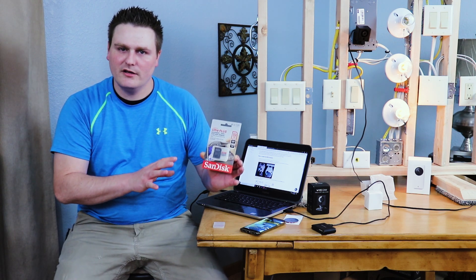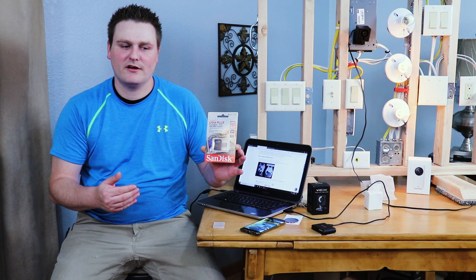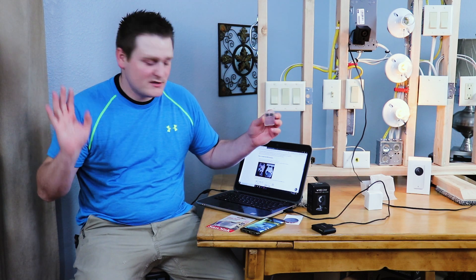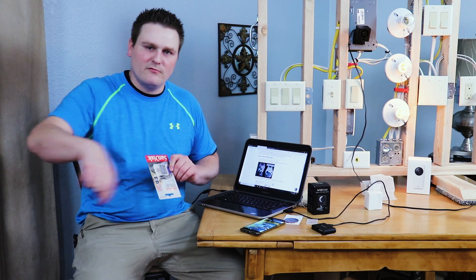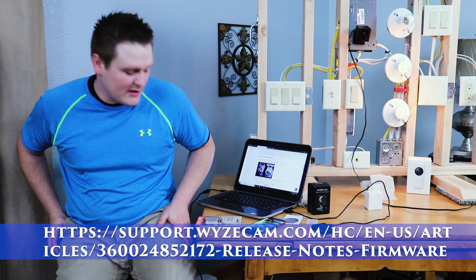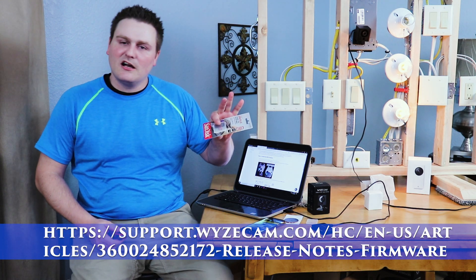It has to have the V10 for it to be able to flash. I tried different brands — just get the V10 and it'll work for you. If you're wondering why your RTSP isn't working or why it's not flashing, this is why. I've watched three or four YouTube videos and none of them mention this, which is very annoying. I'm gonna go to the Wyze webpage — I'll have it linked below where you can download the firmware, and I'll put the SD card info in the comments too.